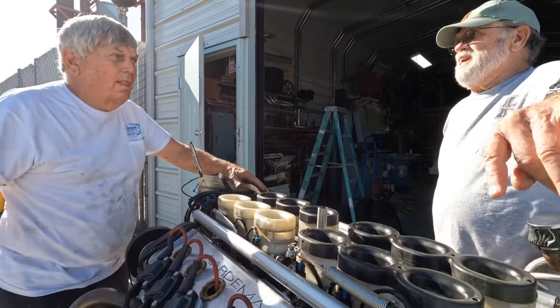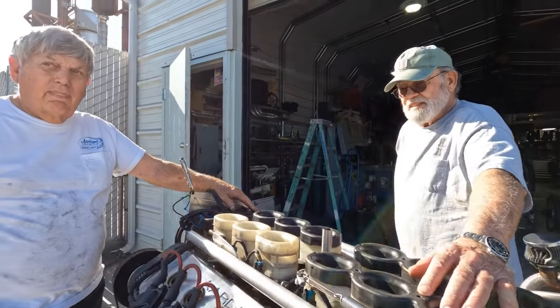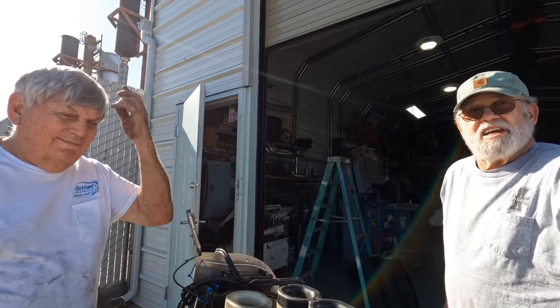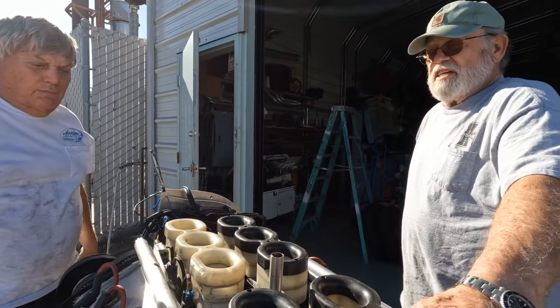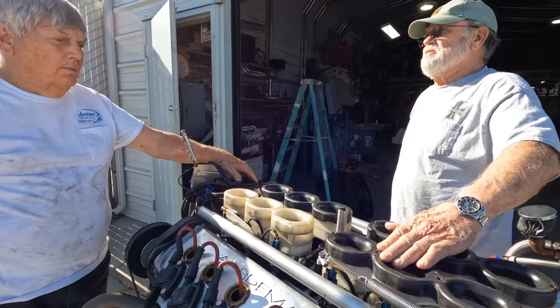You could put a little relief back here. Yeah, I was thinking about that. But the relief, because it's sealed along the box, right? You have the box, so you could just have a relief here, so it would just go out. Out the back of the tail. Either that or you can just richen up these two cylinders with the program, which would probably be better.